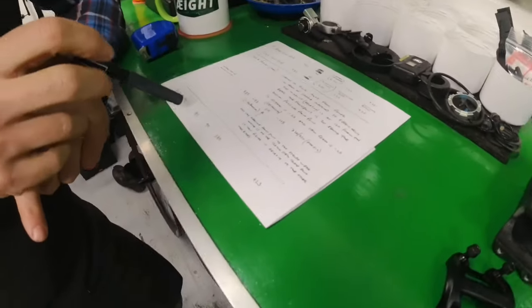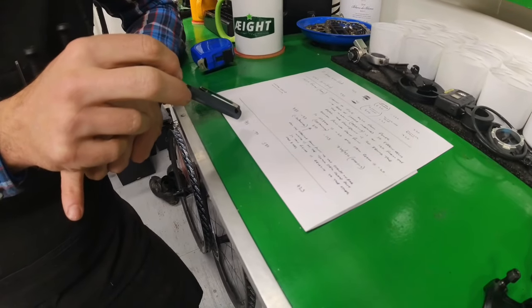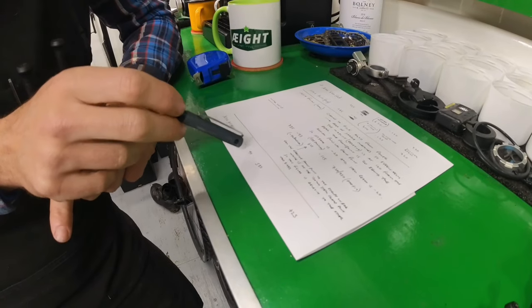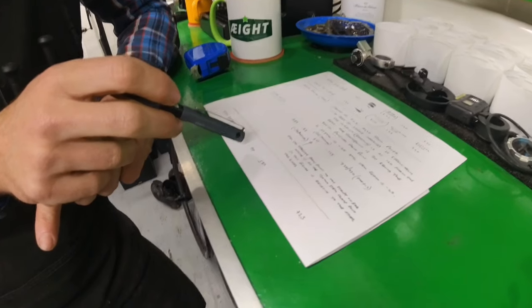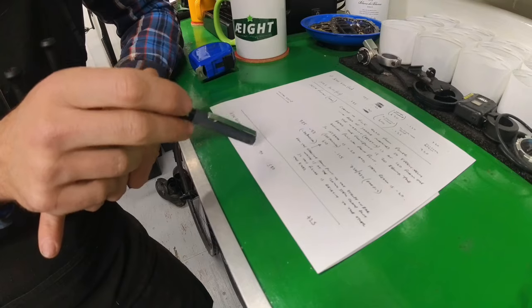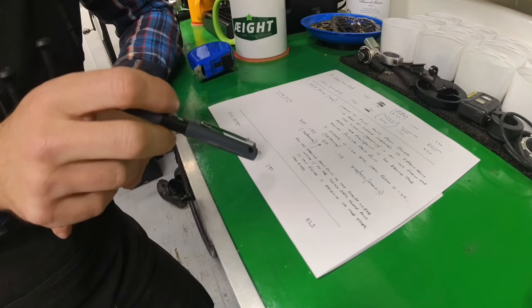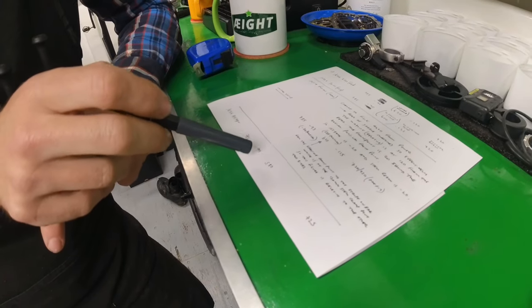So what I like to do with a gravel bike is end up putting the saddle in relation to the pedals in the same position. So the leg length is obviously the same and the setback needs to be the same so that the rider ends up in the same position. But it's the front end of the gravel bike that changes, and especially with the Assassin, because of the longer top tube and the shorter stem that we were talking about.